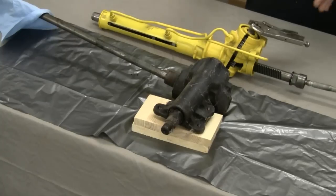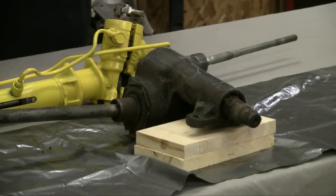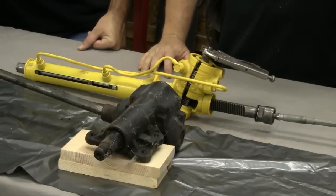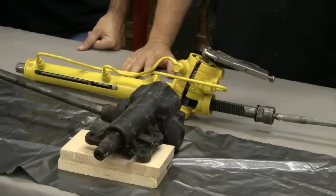People will talk about getting better road feel out of a car with a rack and pinion. Honestly, I don't think the road feel is that much different with the power assist, other than the fact that it's just a lot tighter feeling with something like a rack and pinion — because when you turn the wheel, it's going to go. Depending on what you want to do with a car, rack and pinions are great. They're going to add a very sporty feeling that you're not going to get with a standard box type system using all those lost motion links. If you're going for a straight up driver just going down to the store, a rack and pinion may not be the right choice. If you want a real sporty, razor sharp handling car and you're going to be doing a lot of performance driving, I really think a rack and pinion is a good solution.